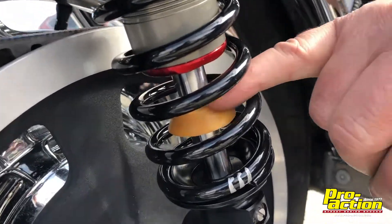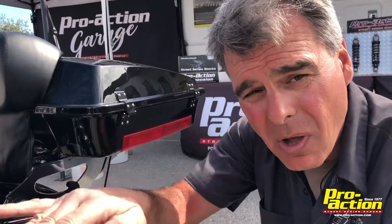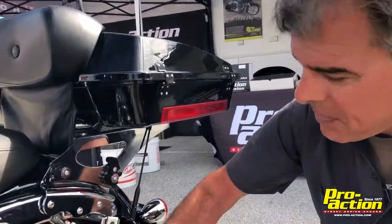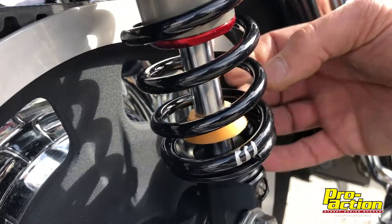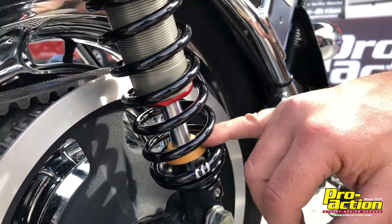So if you take your first ride — your normal ride — out on kind of a flat road, just floating along a little bit, no big potholes, no big curves, just kind of normal float down the road. At that point we want your bumper to come down. We're using not quite all the travel, be a little bit off the bottom, but the main thing is it's going to show us if we're bottoming out and how much travel we're using.